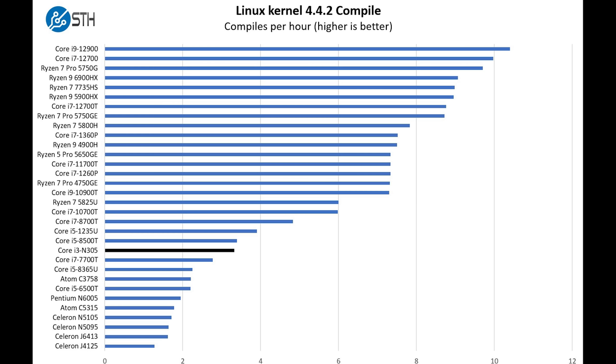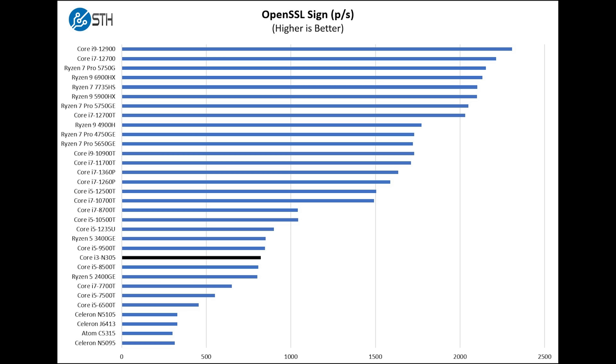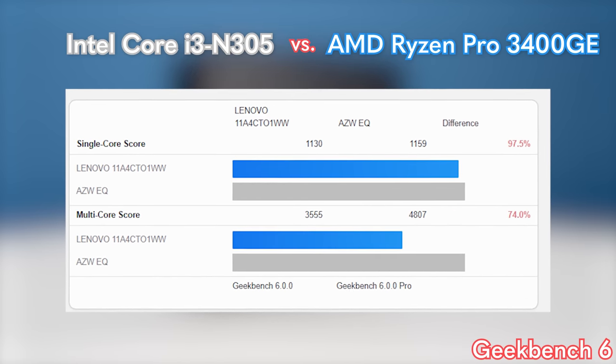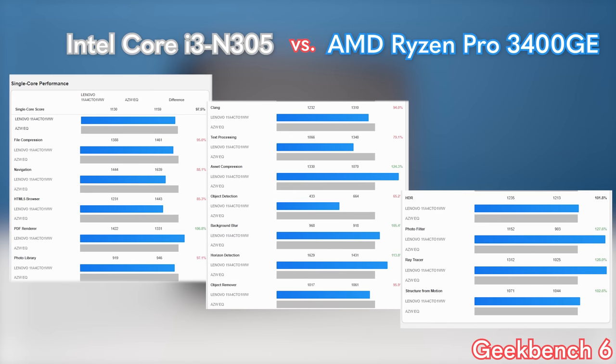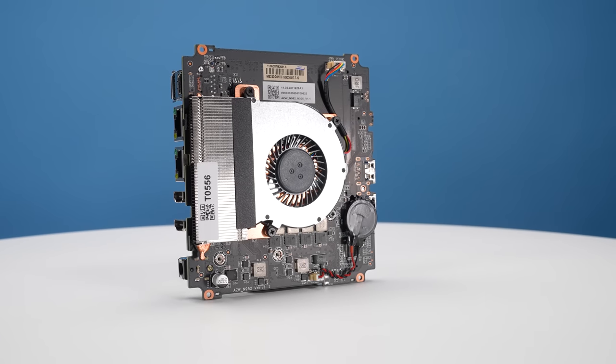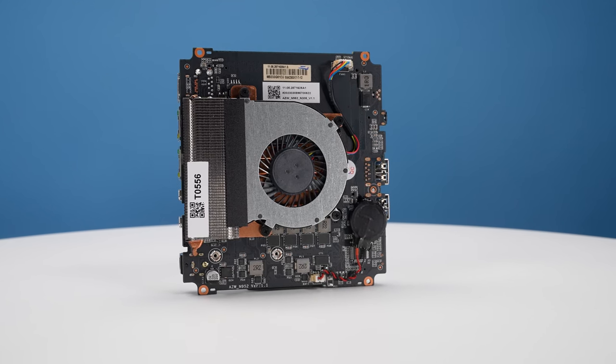The multi-core benchmarks show good performance. Looking at Geekbench results comparing this unit to others, the single-thread performance feels more like a Ryzen 3400GE. On the multi-core side, the eight cores give us a lot of performance — we're not bound by only four cores like on the J4125 generation, or the N5105 and N6005 series. We're not just talking about a couple of megahertz difference versus the N100; we're talking about four more cores.